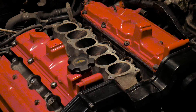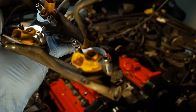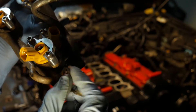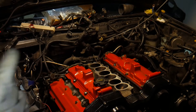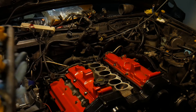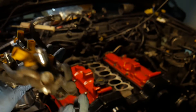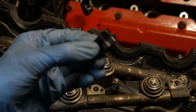Now I'm going to put the fuel rail on and line it up and torque it down. Before I put the fuel rail on the car, I want to quickly mention that there is a ground strap that attaches here — it goes from here and bolts onto the balance tube or the fuel dampener. Also, there are small little grommets, I think they're called insulators — these things basically space out the fuel rail from the plenum.